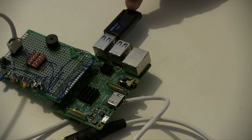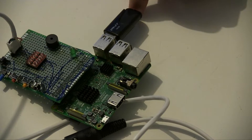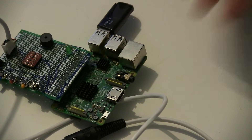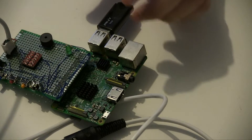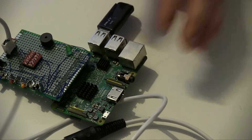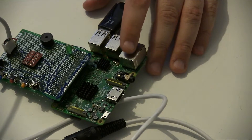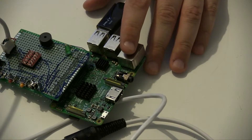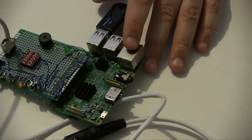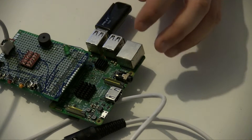I've used an external USB drive. There are apparently issues doing it this way but I haven't encountered any yet, and what it means is I've got a huge, quite cheap storage solution — I've got every single disk image for the Commodore 64 on there, so it's definitely worthwhile trying. In terms of the Raspberry Pi, it's mostly centered around the Pi 3. I haven't seen anything about it being tested on the Pi 4; the actual creator doesn't think it will work because of some changes the Pi 4 made to its GPIO and expansion.